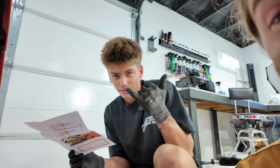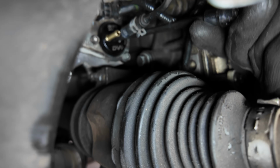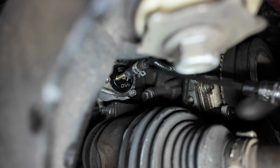Yes. And then it goes to say, but also it doesn't affect the boost pressure, so therefore, if you want to make it looser, go for it. So how much is too loose though? I would just find out what's feeling snug and then back it out a couple and we'll test it. All right, that's all the way. So back it out 4 or 5 turns, at least. Is it sketchy loose though? No. It's like loose, but it's not gonna wobble out loose.